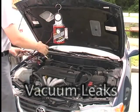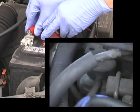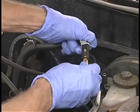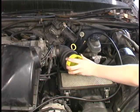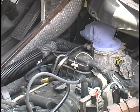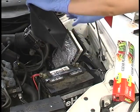The most common leak found in automobiles is a vacuum leak, which can range from a leaky intake manifold to a rotten or broken vacuum line or fitting to a climate control leak under the dashboard. A good choice for introducing smoke into the system is the brake booster vacuum supply line, because every car has one and it doesn't disturb anything else. We must also seal the intake so that smoke cannot escape back through the open intake path. The yellow cap plugs provided will seal most applications. A quick tip is to cover the sealing surface of the air filter with plastic wrap and reinstall the air filter.